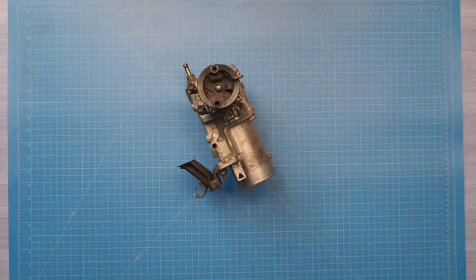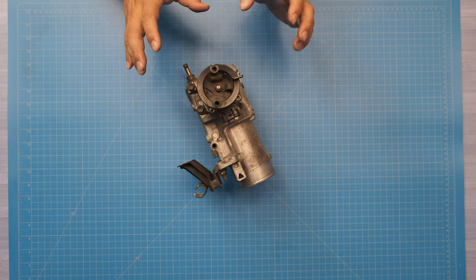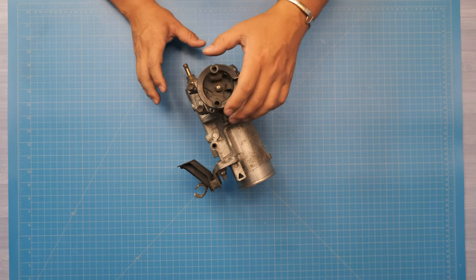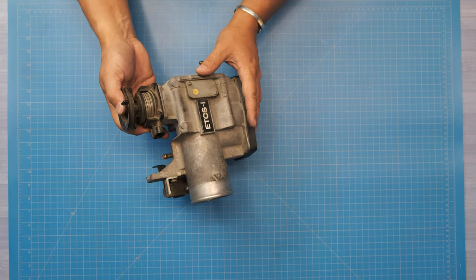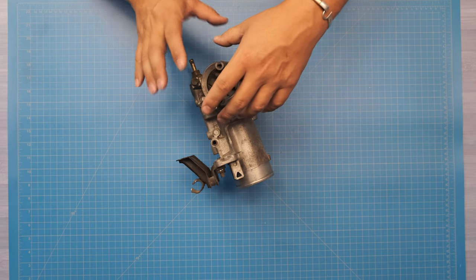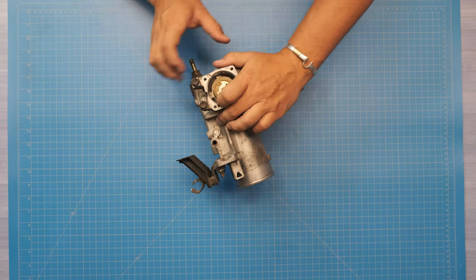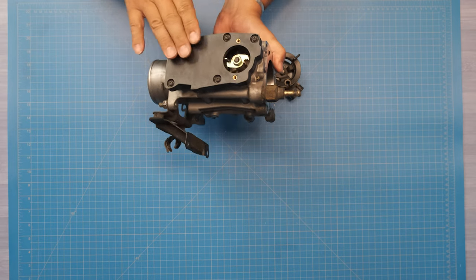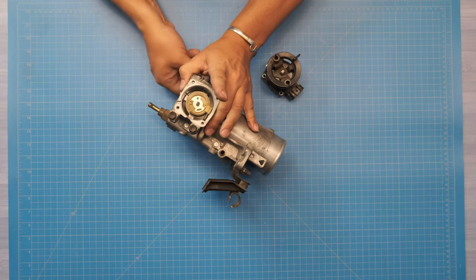Today is a little bit different type of project - I'm going to design a car part from start to finish and walk you through it so you can see exactly the basic steps involved. In this case I've already disassembled this, but this is a 2JZ-GE throttle body off an '01 to '05 IS300, '98 to '05 GS300, that sort of thing. We've got the APP sensor here, throttle blade control here.